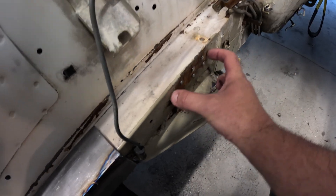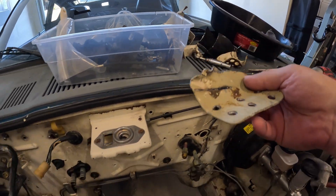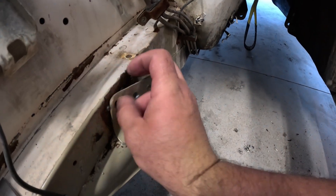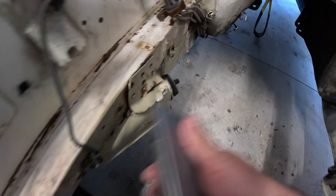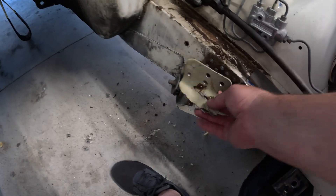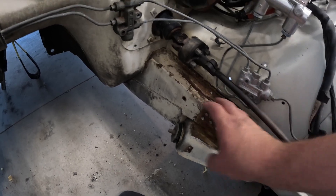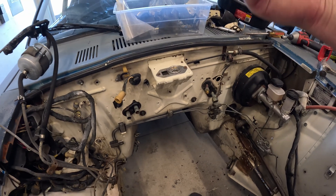I don't know if it's on all S30s, but in particular the 280Z has a plate gusset here to reinforce these lower arm points, and this one is over here on the other side. To get my plate on there I had to remove that — not too big of a deal. I'll go back and re-gusset along the edge here, maybe bring it out a little bit more. This side is a slightly different shape — I don't know if that's just a production variation. I need to grind these flat, clean them down to bare metal, and get these welded in place. But I'm not quite sure on the exact location until we get the engine in. Everything is going to get tacked together, pull the motor back out, and then do final welding.